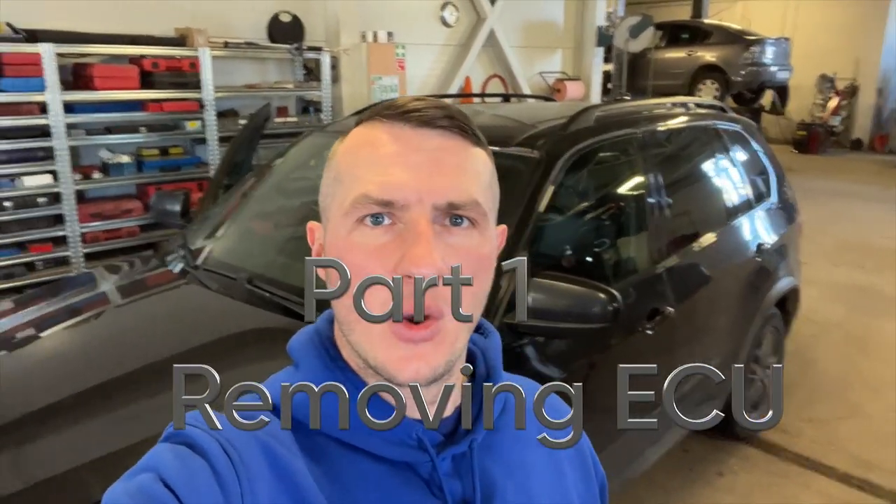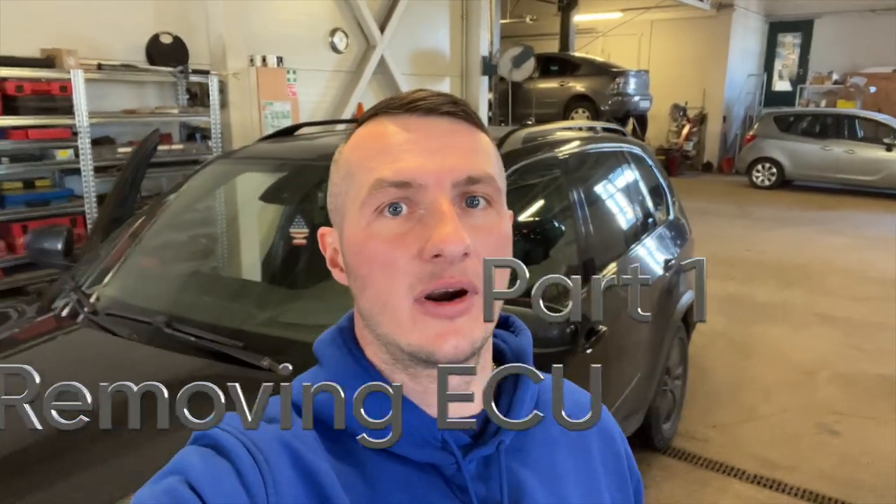Today's job I'll divide into two parts. The first is physical removal of the ECU and the second one is coding. Why is it very important to physically remove the ECU from the car? Because if you go straight to coding and decode that option out from the car, but the ECU is still present, the car will know that something is wrong. The same ECU will continue sending signals — basically saying 'I'm present here and something is wrong with me.' That's why even if you do all the right coding without disabling the ECU itself, it will not help. So step one: disabling the ECU.